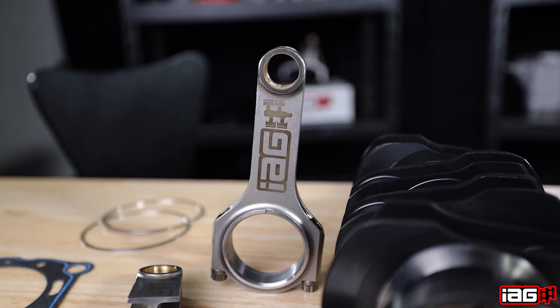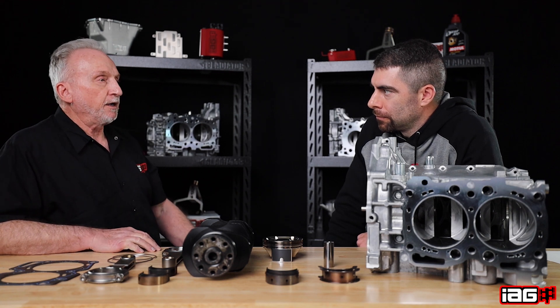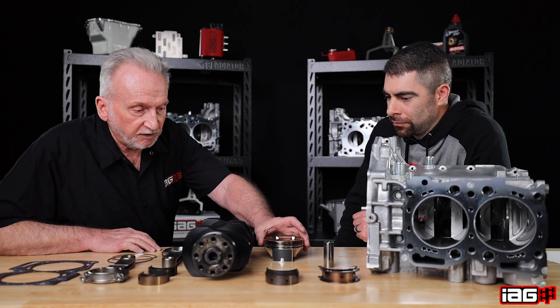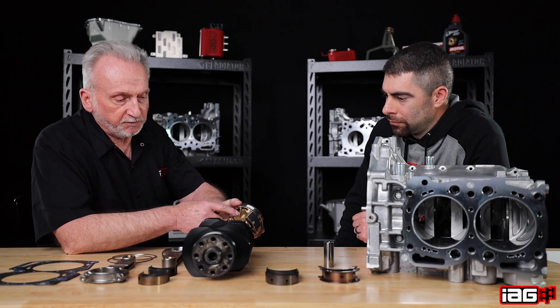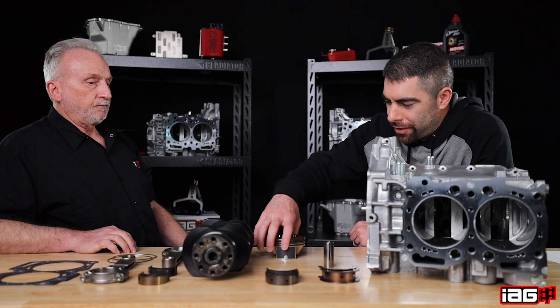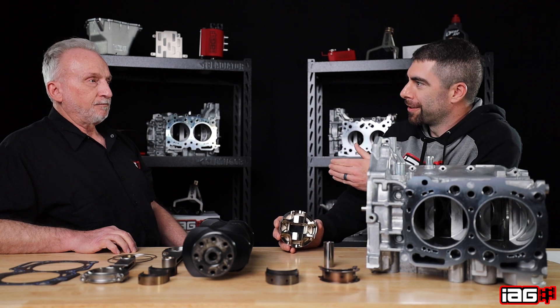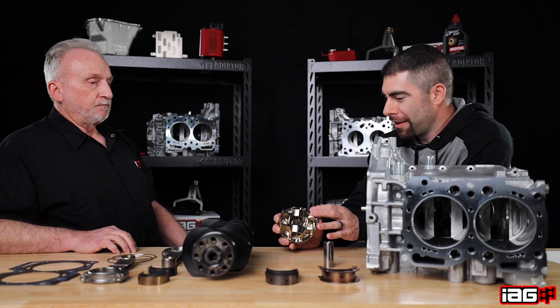Any upgrade in the rods? Yes. With our Madden rod, it's the same style H-beam except with 625 Plus ARP rod bolts, but we run a two millimeter longer rod. That improves the rod ratio with the motor as far as RPM, and changes the piston speed and load on the piston. Which also means we have a different piston — the wrist pin has been raised up in the piston, closer to the oil ring. So when you say a plus two rod, the rod is longer, but they've moved the wrist pin hole up — it's going to protrude the piston out, but that's been compensated for.